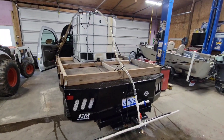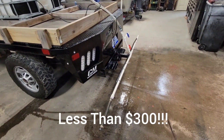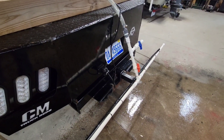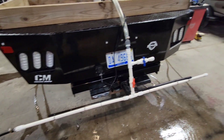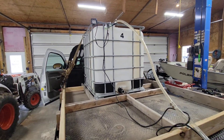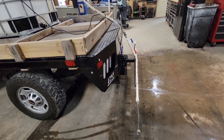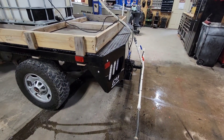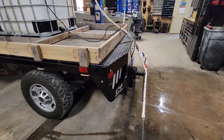So you can basically build this setup to spray chloride for any pickup truck — you might have a couple hundred bucks into all this. You need a little bit of welding skill to put that metal bar together, and then simple plumbing skills to put the spray bar together. All these supplies can be picked up at your local Ace Hardware or Home Depot. It may not be fancy like those ones with the pumps and recirculation valves, but this thing works. Instead of investing thousands or tens of thousands, you can have a nice spraying system for a couple hundred bucks and make a bunch of money.